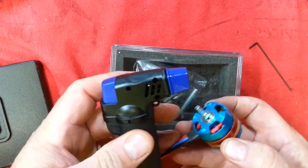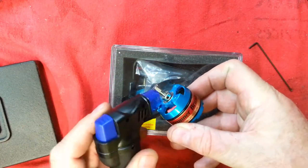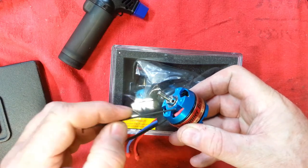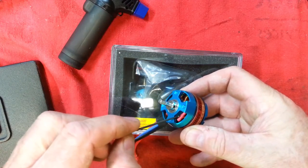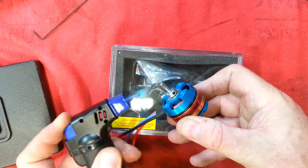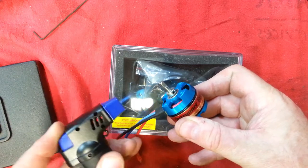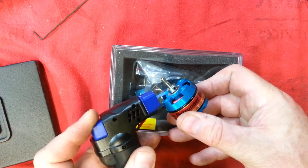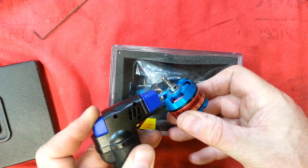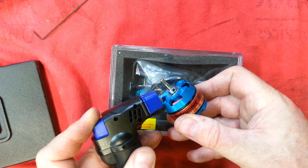Here we go — this is going to be in actual time, and hopefully you can see there will be a little moisture. I'm going to put the tip of the flame right here, trying not to let it lick in here. I don't want to burn anything here, and this is one of the reasons why I have a very small torch so I can control the flame. The blue flame is licking out to where it's just touching the tip of the shaft. Notice the moisture — like a little white cloud on the wheel collar. I've got about the tip of the visible blue flame right here on there.